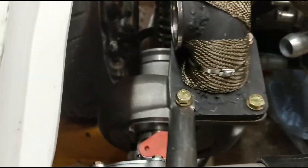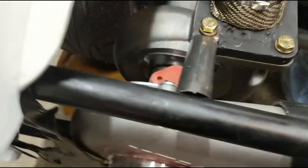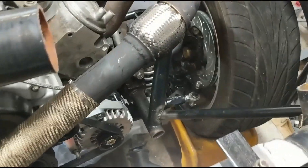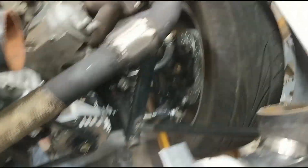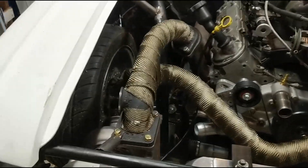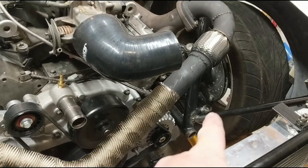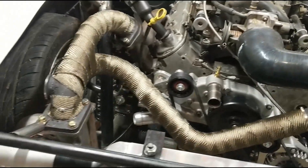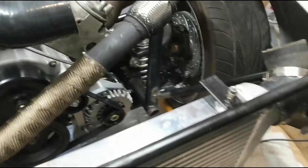Here's what we came up with — just cut a little piece of tube, left the tab on it, bolt that to the turbo right there, get this welded, and that'll support it there. And that one supports it there. Next time we take this apart — which hopefully will be a long time from now — I'm just going to cut this bar and sleeve it and we'll have a bolt there. That way this part will be removable so the motor comes in and out nice and easy. That's the plan — go get the welder, get this cleaned up, get it welded, and then we'll probably go dig out the radiator and figure out how we're going to make the bottom radiator mounts to support the radiator.